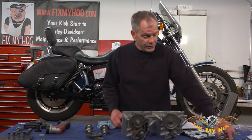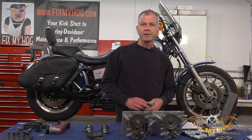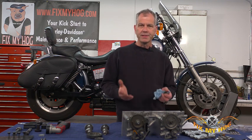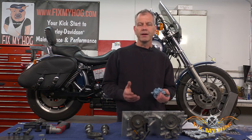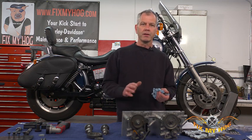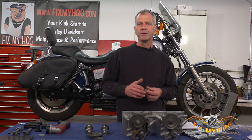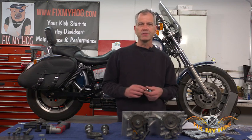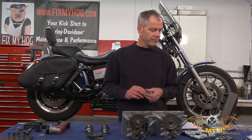Most of the bikes we're looking for torque, and with it comes horsepower. The number one thing you do when you get the cams out is check the runout on the crank — they're saying three thou, some people push it on that. If it is excessive, like in 2007 and later when they went to the hydraulic cam chain setup, the crank runout got extremely bad and they opened up the tolerance. We really have a hard time putting gear drive in '07 and later unless the crankshaft is updated to S&S flywheels or you take the factory crank, send it out, have it trued and pro-plugged.